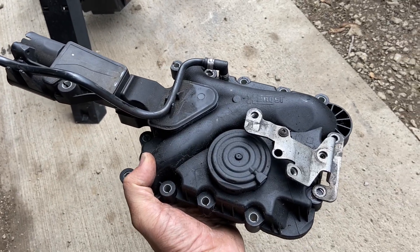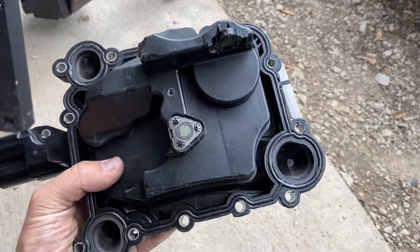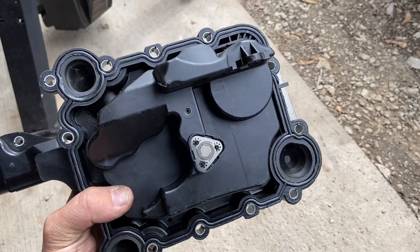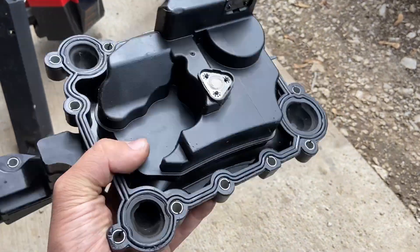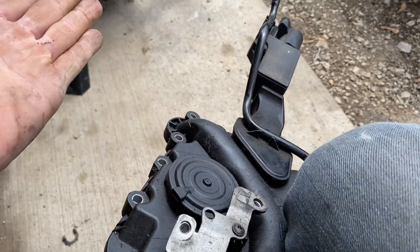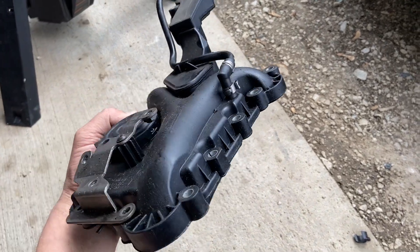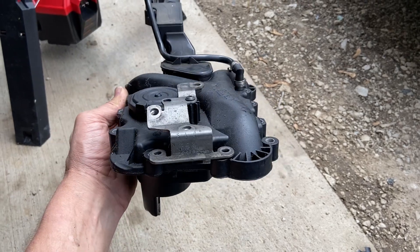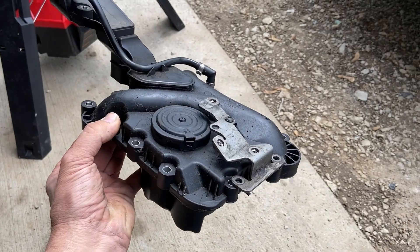Keep an eye on that kind of stuff. If you have a coolant leak, most of the time it's not going to be that — most of the time it's going to be external — but I want people to be aware of this kind of thing. If you can think of anything else I'm not thinking of, tell me in the comments. This is the type of oil breather assembly I was talking about — the oil separator. It is connected with the pressurized cooling system and it can fail internally and mix the oil with the coolant. This sits in the valley, so either cylinder head is on either side and the intake sits on top of it. Be aware — it could be something as simple as this for your coolant leak, mixing with oil, creating sludge, destroying your engine.